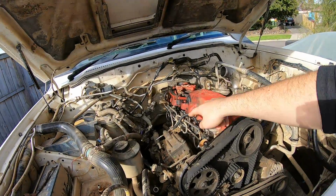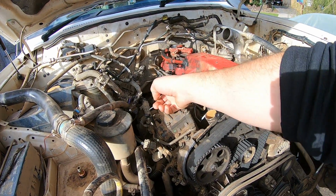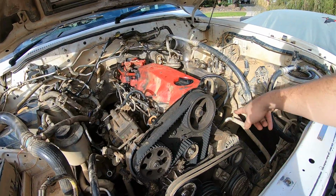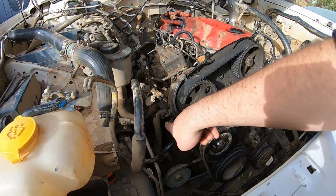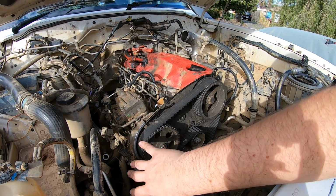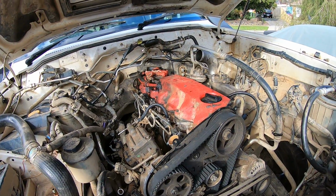What I'm going to do is get the engine ready to come out by taking those 2 bell housing bolts out the back and the 2 starter bolts here. Then we'll try to get all those bell housing bolts free, crack the engine mount one over there, and just got to do this one here, which isn't too bad. I left them sort of loose when I put the motor back in, because they are a pain in the ass to get to. Other than that, let's get into taking this motor out, or apart, and get ready to come out. So I'm excited.